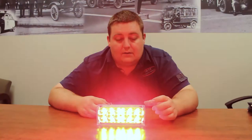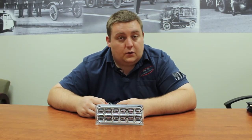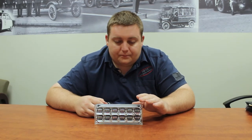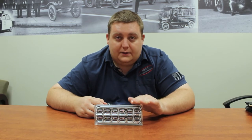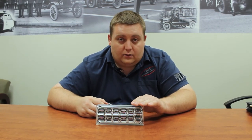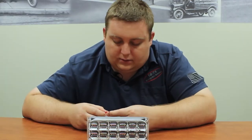What this does is it helps reduce cost and allows the light to be multi-purpose, requiring less mounting and less wiring in the vehicle. So if you're doing a fire truck or a small utility vehicle and you have the 7x3 M-Power on the sides of your body and you do blueprint, you're already just running two wires and you can now get multi-features out of it. You can have it flash just red in park, flash red-white in response or intersection mode, and also have the white override — all accomplished with just two wires, including a steady white override.